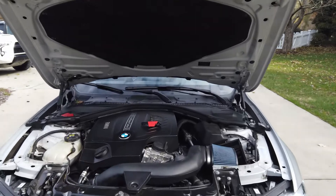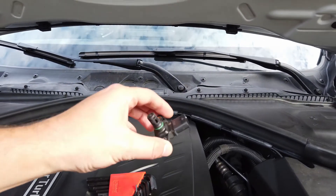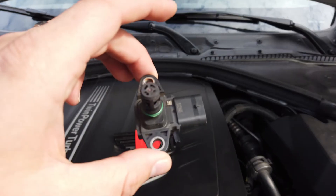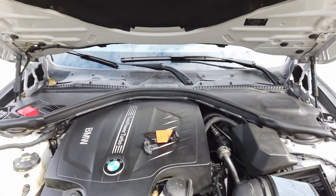The install was not bad at all. We have our stock sensor — we're going to put that somewhere safe. The one thing I want to tell you guys is be careful with these o-rings. You can see that this one actually tore while I was taking it out, so just be aware — you want to be really careful with those when you're taking them out and putting them in.